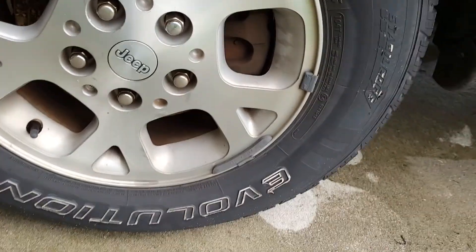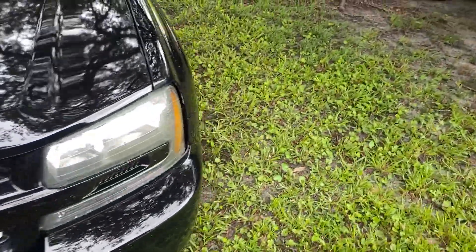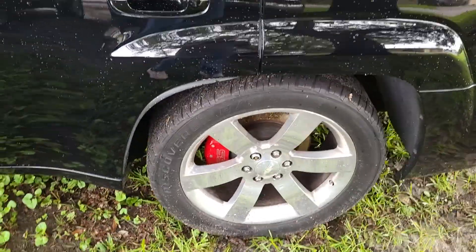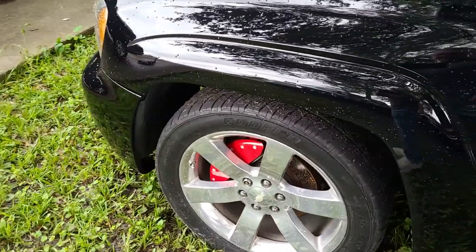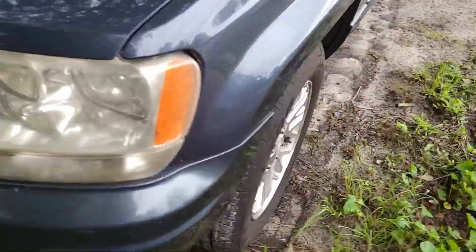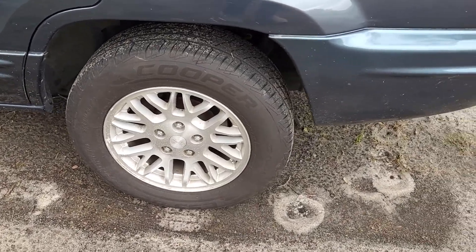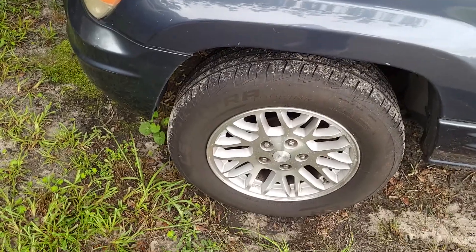Another story on this - I'm about to get new tires for my Trailblazer. I bought the Trailblazer with these tires on it and I get some vibration on the interstate around 70-75 mph, but then it goes away when you get up to 80. One out of the four has clip-on weights. I like sticky weights. On this one I mounted the tires myself, made sure the red dot was at the valve stem, and got them balanced with sticky weights.